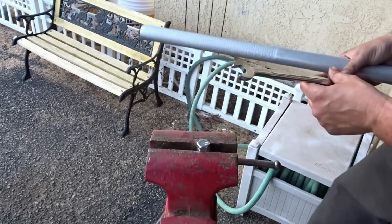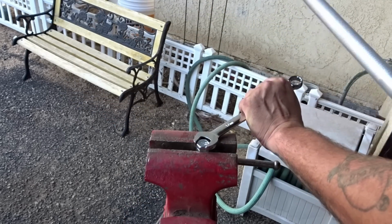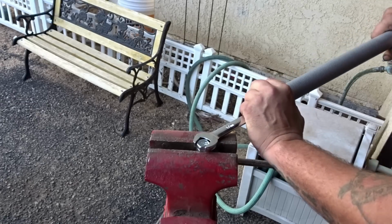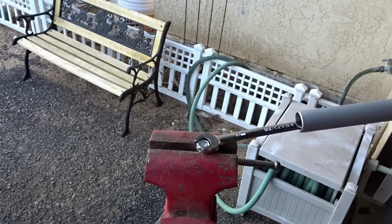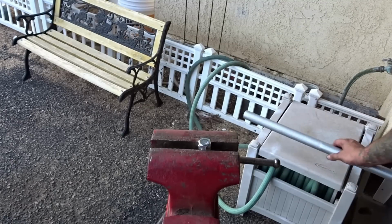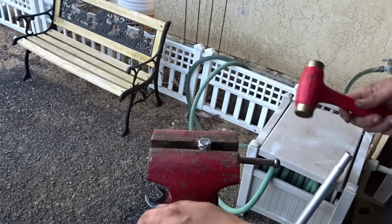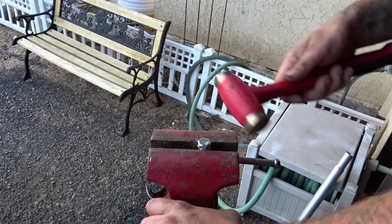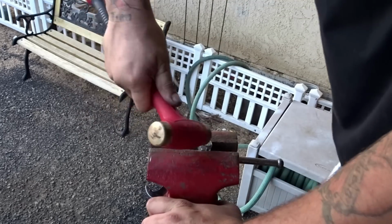Like I said, guys, I had this thing dug in really good. Hammer it in there. If I have it completely set, this bolt continues to bite and turn with the wrench. So this is not an easy task, trying to round it with this wrench. So now let me see if we can try something else, because what we're trying to do is round the edges of this bolt. So let me just smack on the edges of it with the hammer.